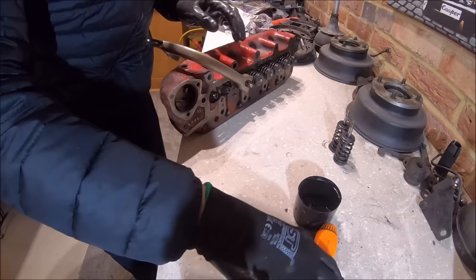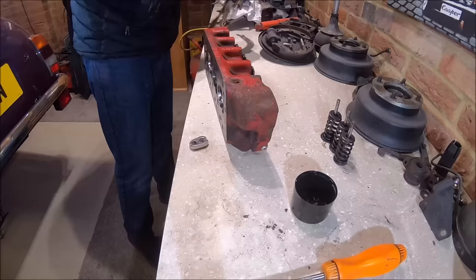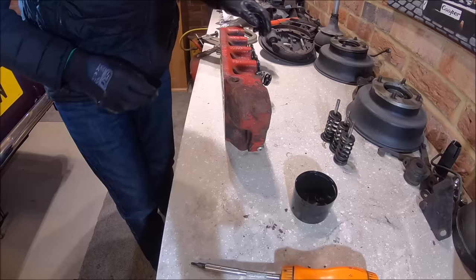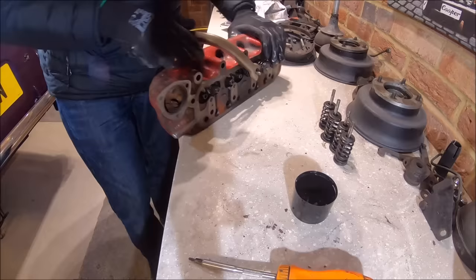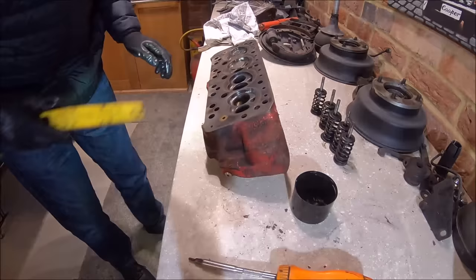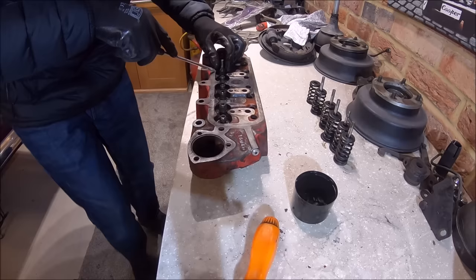This head is a little bit interesting — it looks like it's been ported and polished, it definitely has bigger valves, but it only has single valve springs. The head work looks to be done to a reasonably good standard, but the combustion chambers certainly don't look like they've been matched for exact cc. So it's quite a bonus to find out it has a modified head, but I don't think it's the best work done.